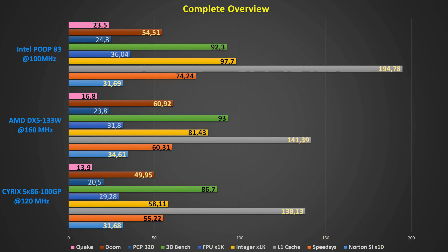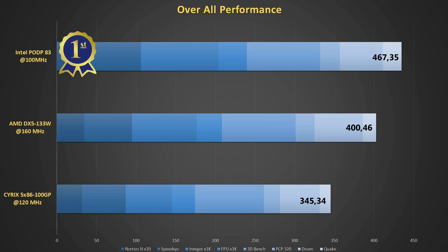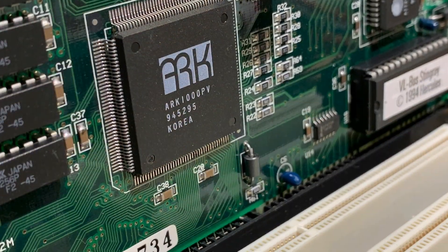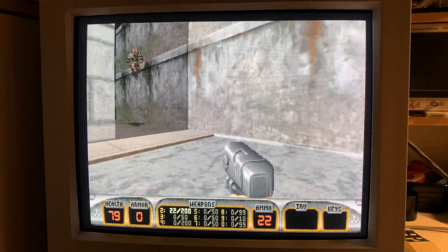If we put all results into a chart, we can already guess who the winner is. The cache benchmark I will not take into consideration for the final rating, as cache speed influences all other benchmarks anyway. The top performer is the Pentium Overdrive — with 60MHz less than the AMD, it clearly shows the advantage of this technology. Nevertheless, the AMD took a good second place and defended its legend very well as the fastest 486 CPU. I was a bit disappointed by the Cyrix and expected much more. Maybe the Cyrix performance can be increased by enabling certain bits and functions via special programs — maybe that in another video. At the end we got 3 solid CPUs which handle overclocking nicely, and the whole setup here you can definitely call a high-end Socket 3 setup. I hope you enjoyed this video — if so, please subscribe, thumbs up, and leave me some comments. Thank you very much for watching and see you next time.